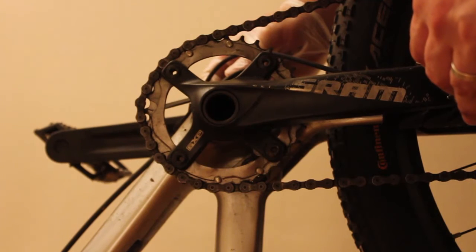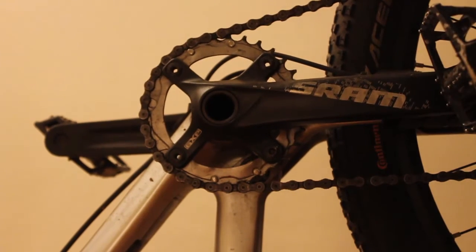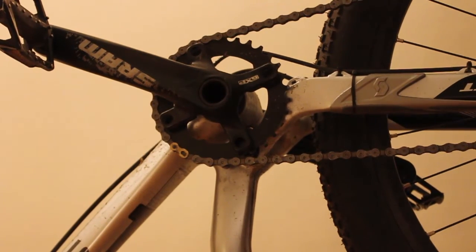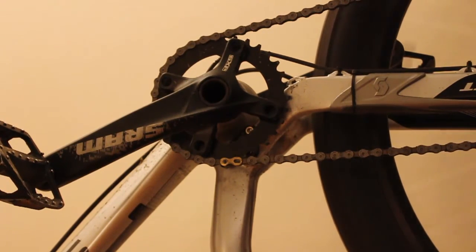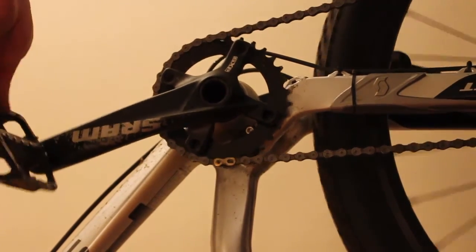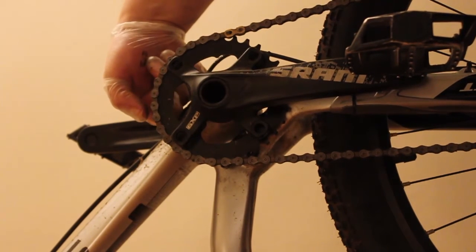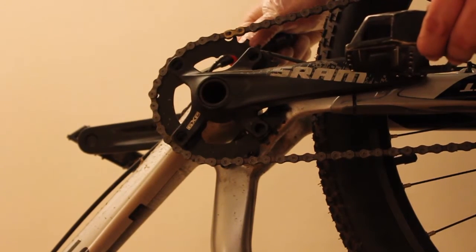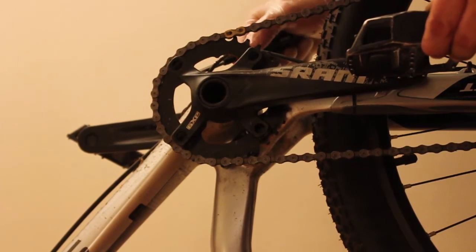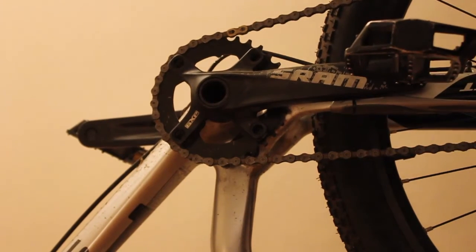As a comparison, the other bike that I'm going to show you in a few seconds has done maybe 500 kilometers, if that. If you look at the teeth on the front chain ring now, you will see a huge difference in the profile. This is technically a new chain and front chain ring, and the other one was quite heavily used. This chain has also done 500 kilometers or less, and as you can see, it's very, very difficult for me to stretch it, which means that it's tighter, more firm, and it hasn't worn out yet. It will in a few thousand kilometers.